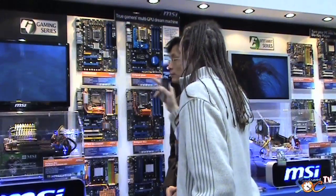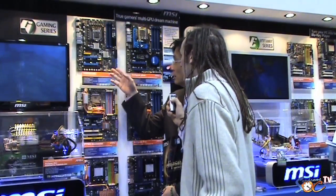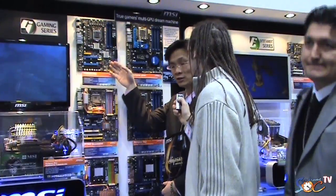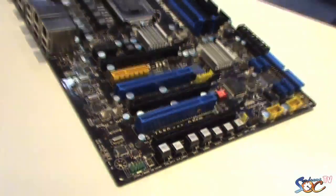So it is like unlocking the BIOS through jumpers? Yes. As you can see, it has the same easy access switches as the other board. It is similar to the old P4 series motherboards — it lets you jump FSB levels, like from 133 to 166 or to 200.